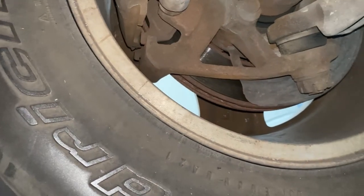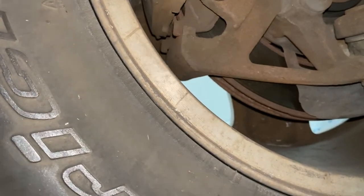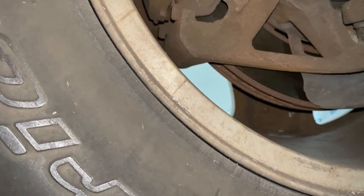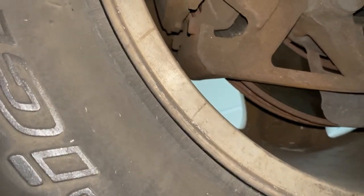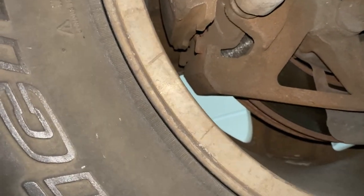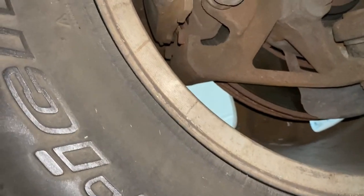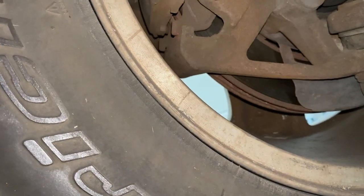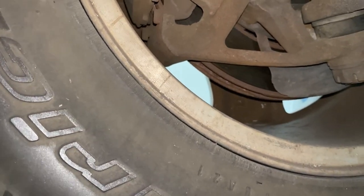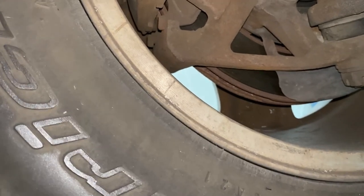First test: you drive the Jeep and touch the disc brake to make sure it's cool — without using the brakes at all, meaning you downshift and use the emergency brake to stop, for two miles or more, to make sure the brakes aren't rubbing. Sure enough, they were cold to the touch. Then you do another two mile drive and see that they're a little bit warm to the touch after two miles of driving using regular brakes. So my brakes are working perfectly normal. Next we'll test with the RV.